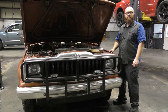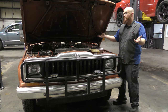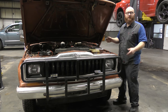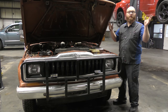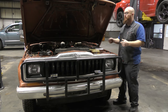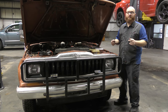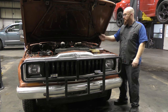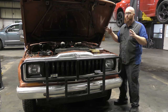How is it that all of a sudden those things start going bad when it's in your shop? The fact is they were already bad, but there was no way to tell until you can get the engine running. It was non-running - no way to start it and test when it came in. We got it on the lift, checked for leaks, and it was literally pouring out of the rear main seal. The customer may have known about it a year or two ago and forgotten, or maybe it set long enough that it dried out and went bad. These are the situations where, even though this guy was very understanding, I have had customers who are not. They say 'you didn't quote me that.' How can I quote that if I don't know it's bad? There's no way to know until we get it running. That's one of the reasons I shy away from jobs that are half done - I don't know what hidden surprises are there.